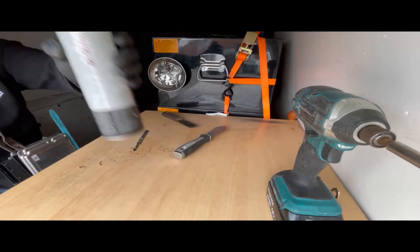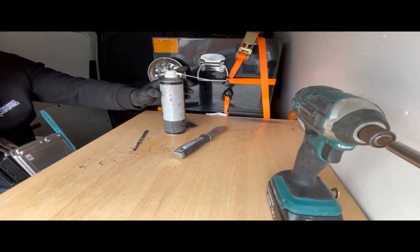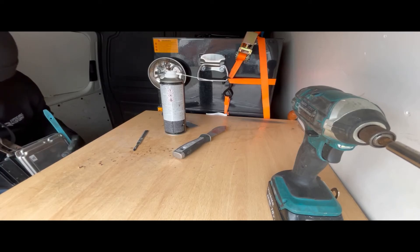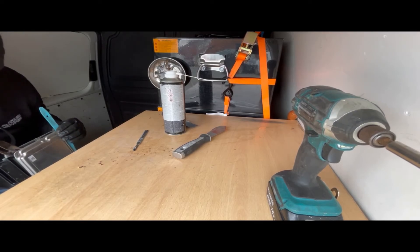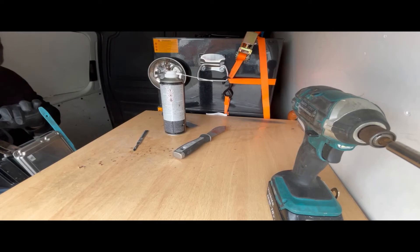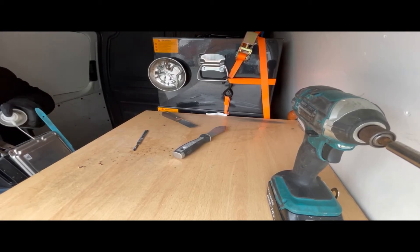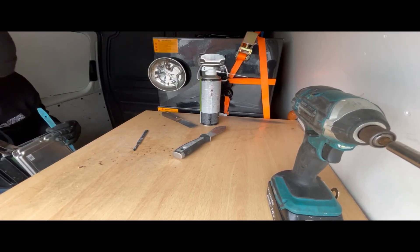So I've got a good view of the ECU now. I'm going to spray some more carb cleaner on the bottom heat shield. I'm just going to keep the pressure of the pliers and wait for the heat paste at the bottom to come away. It's starting to come away now. You'll just see the line slowly going across the bottom, getting bigger and bigger. Nice and slow — a bit more carb cleaner to get it into the crack. Just keep applying the pressure with this tool. Fantastic tool this is for opening up ECUs if you're doing it regularly.